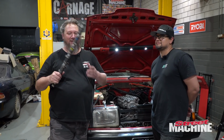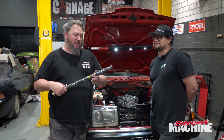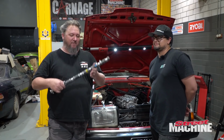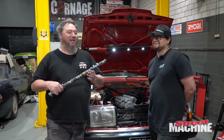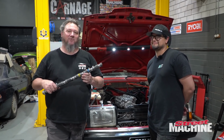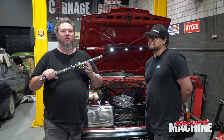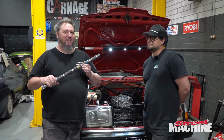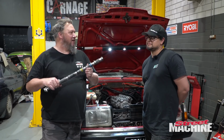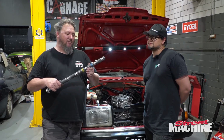Last time on Carnage, we tried to put some cams in the Trolvo, and then I had an oopsie and snapped one in two. So Golby's have sent us down a new cam, and we will send them some money for that shortly. But I've asked Gerardo from G-Force Racing Solutions to come in and show me the proper way to do it. Plus, we need to do some measuring because this cam may not actually be exactly the same size as the old cam. So we've got to check our shimless buckets and our clearances and all that sort of stuff.